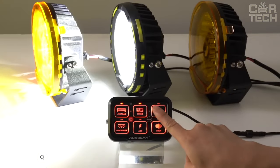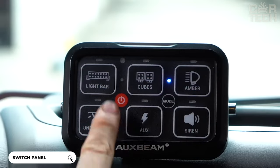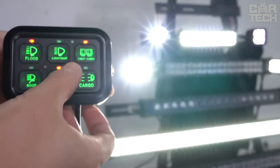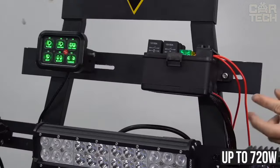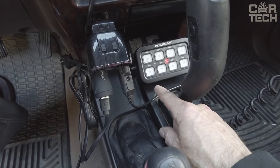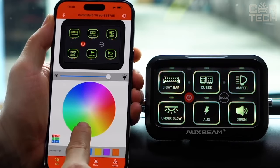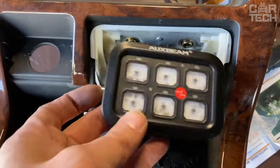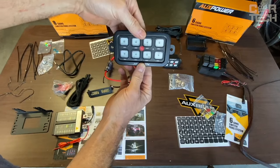The 6-channel car control panel allows you to unify control of all your accessories in one place and eliminates wiring tangles. The 6 circuits can power any 12-volt device with a total power of up to 720 watts, and the maximum current of each circuit is 60 amps. A special feature is the automatic brightness adjustment of the button backlighting — dim in the dark and brighter in daytime.